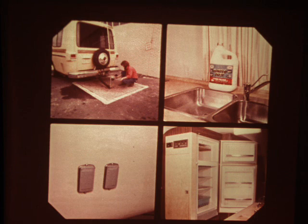If you don't use your motorhome in the winter, the winterizing services your GMC service department can perform for you still include draining the water system and adding non-toxic, non-flammable antifreeze. In addition, all the exterior vents will be taped and the interior will be thoroughly cleaned and aired out. Other winterizing preparation includes draining the air suspension reservoir, checking the battery fluid level and specific gravity, and coating exterior parts that could rust with grease.